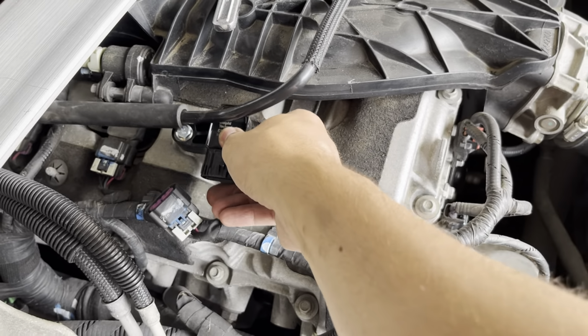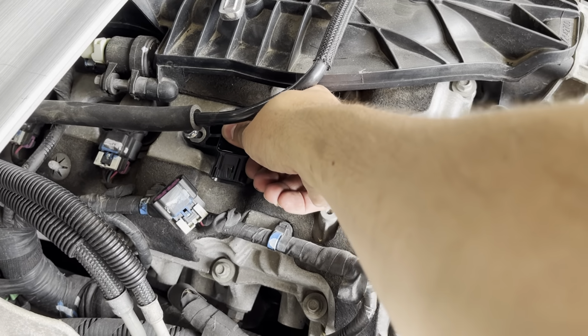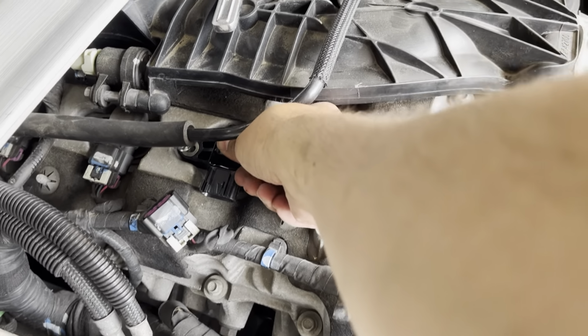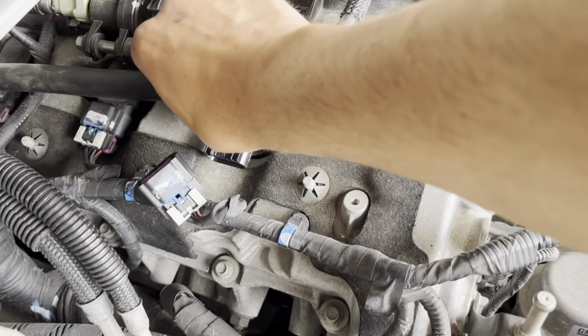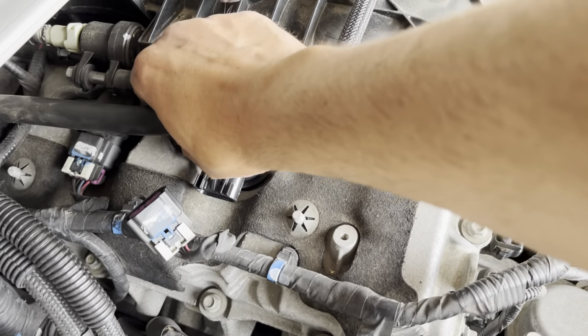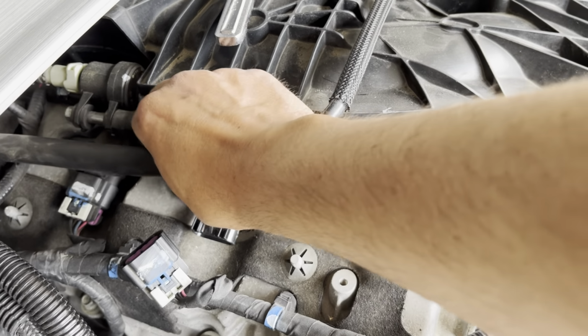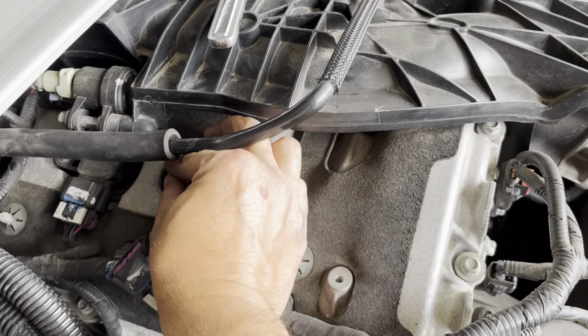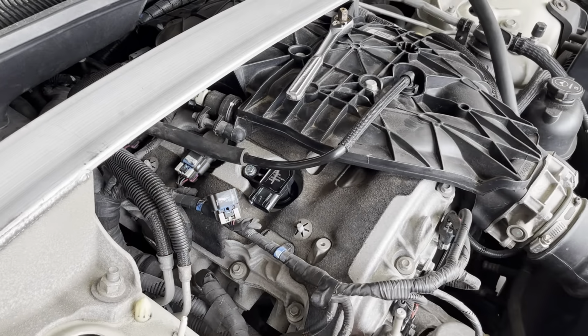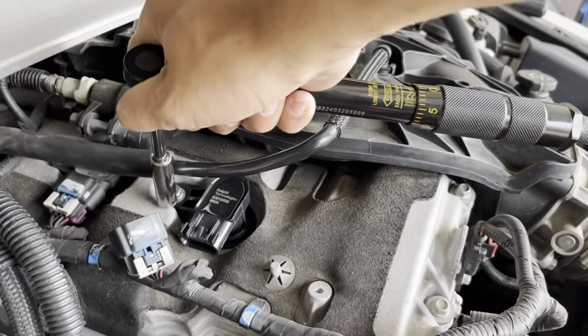Put it in, same thing, be gentle, you don't want to break your spark plug. There's really not a wrong way to get that in there, especially since the bolt guides it down. Okay, once that's finger tight, we'll get our torque wrench. We'll torque it to the specification. Okay, now we're ready to tighten it.